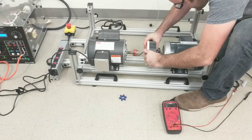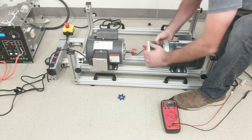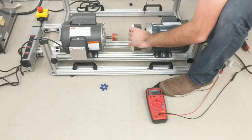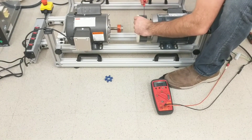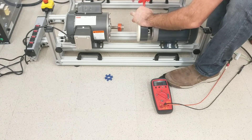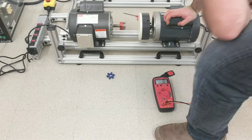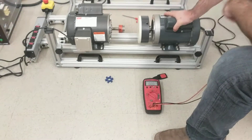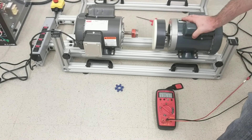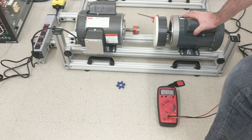I'm using the keyway and a big heavy load to simulate a load going into the agitator. I just want that 180 to grab it. Now this isn't going anywhere. Plug that in. I've done this before, and this isn't going to do a whole lot, but you may as well plug it in. It's at six amps. Why don't you unplug it for a second — I want to show you something.